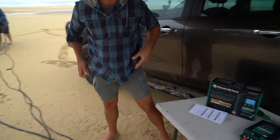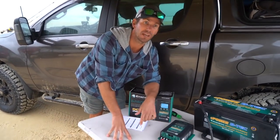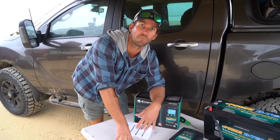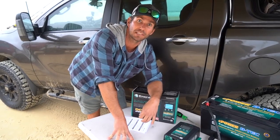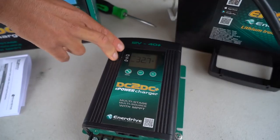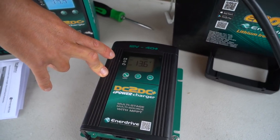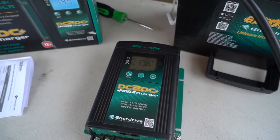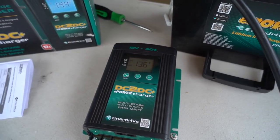This unit here, the e-powered DC to DC, is actually capable of punching out 50 amps. With this big 16mm cable, we should get well above 40 amps when it kicks in. You can go even bigger if you want, but you'll see here when we punch out well over 40 amps — it's probably about as big as you need to go for a good 10 meter run, which most people will do from their car to their caravan. At idle it's nearly 38 amps. Dave will ramp it up and we're going to go well over 40 amps just by going up in cable size. High idle: 42 and a half amps. How good's that?